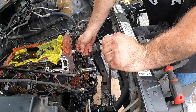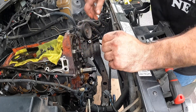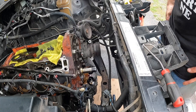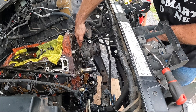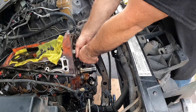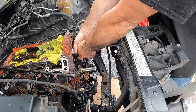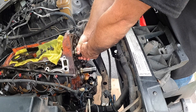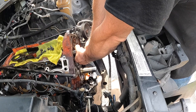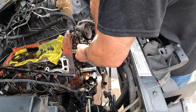You're going to need something that's going to give you some type of leverage holding on this camshaft. Before I actually start removing it, I'm going to make sure that the condenser is out of the way and everything is clear enough so I can get the camshaft out — it's probably going to occupy this much space, if not more. Slow and steady is the way to be. I'm going to pull this out as level as I can, because you're going to have to get it past all the different cam bearings. You don't really want to knock it on them, so that's why you want this bolt — to keep it as level as possible when sliding it out.